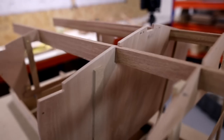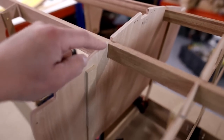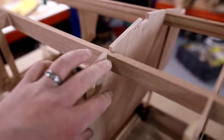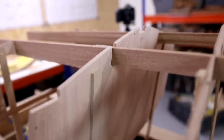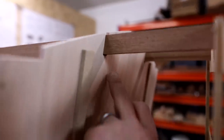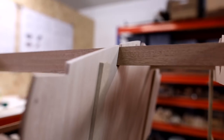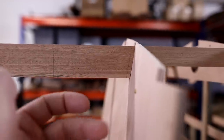And that's going to be beveled in the same way that we did the bevels on the transom support legs. So if you can't remember back to that, basically anything that's beveled within this boat is beveled until the larger side of the opening touches whatever part it's going through. So obviously everything on a CNC is cut at 90 degrees typically, and the cutout for this stringer here is cut at 90 degrees, but it's sized so that when the far side, so this side round here, is taken down to match the bevel of the stringer, this side should be just seated.